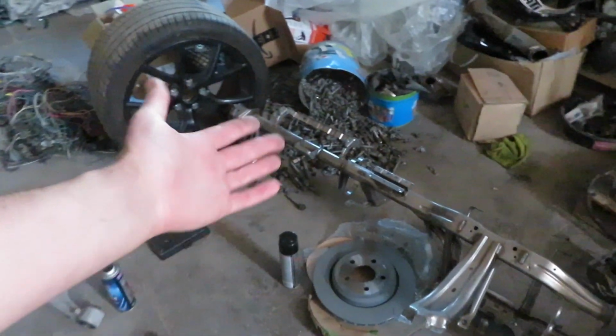What I'm going to end up doing is Cerakote has a really nice product, which is Glacier C7600, a high temp coating, which is an air cured coating, and it has a really nice shock rating. So if I get my rotors super red hot, drive through a puddle, it can handle going from that extreme temperature to water getting splashed right onto it. So it's not going to flake, it's not going to chip, and it also works in high heat and it dissipates heat very well.